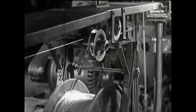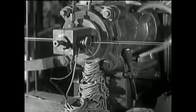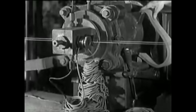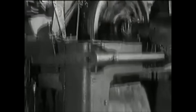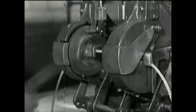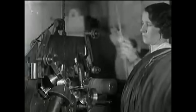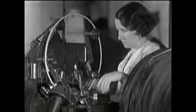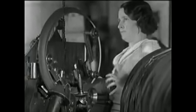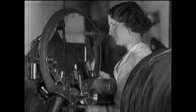Another important part of a tire is the bead. The wire used has a breaking strength of 280,000 pounds per square inch. Each strand is thoroughly insulated with a special rubber compound, then automatically formed into a circular band. The spliced ends are taped and covered with a special rubberized fabric called a flipper, which is used to anchor the bead to the body of the tire.